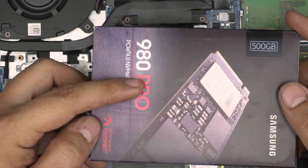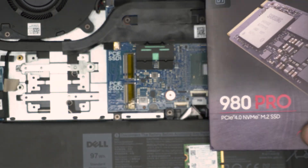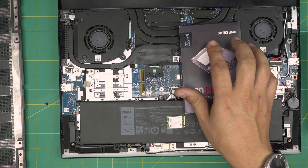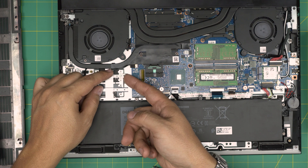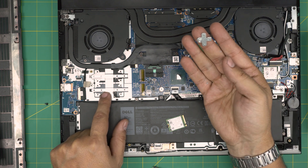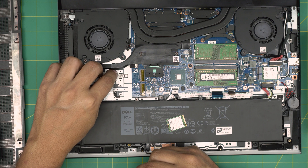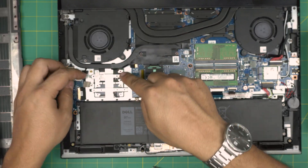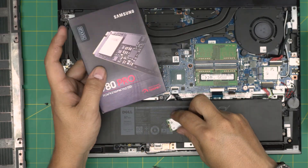To replace it with a full-size NVMe, I recommend the Samsung 980 Pro — very durable and long-lasting, better than most NVMe options. You can also go with a Western Digital Black as a more affordable option. You can go from 500GB up to 2TB, and you could put a 2TB in each slot. You'll need to slide the riser bracket from one position to the other. Unfortunately they only include one riser — finding a second one will be challenging. I'll check AliExpress and leave a link in the description.